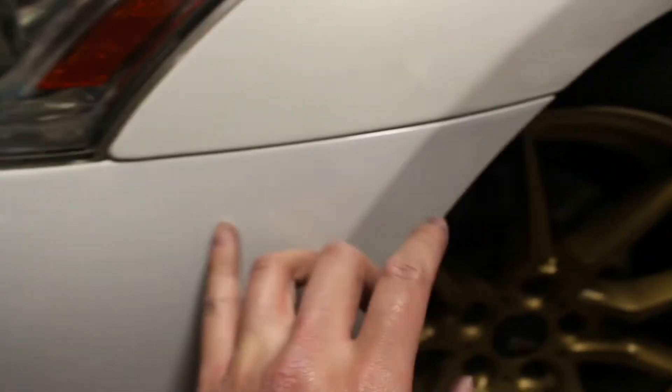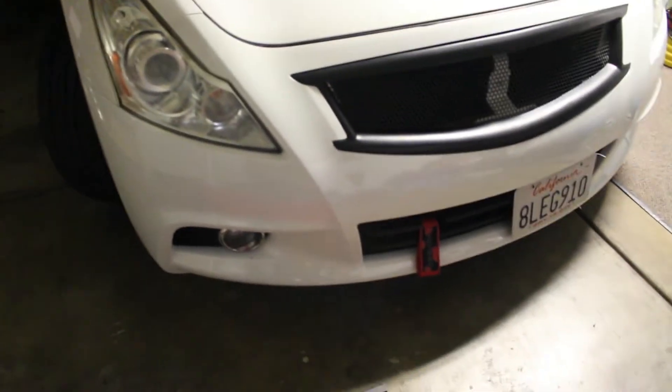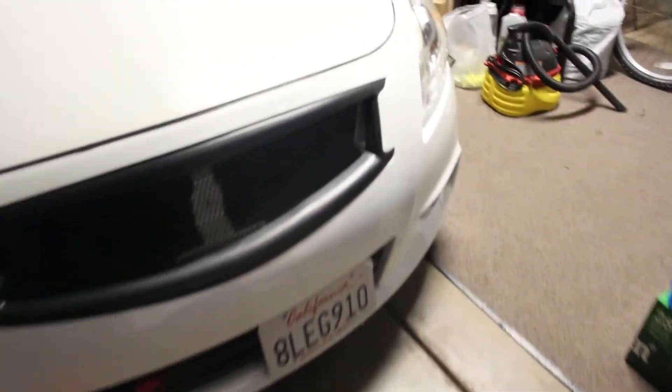Fake G37 sedan sport — fake sport fitment off, it's pretty clean all around. Don't forget that you need to reuse the brackets on the sides — just pull them out, and there's also a rubber lining to stop water from coming in. You need to pull that off and put it back onto the new bumper. There are also little metal pieces at the bottom of the bumper where your undershield clips or screws onto — pull those off and put them on the new one, then you're good.